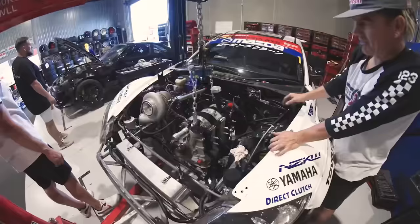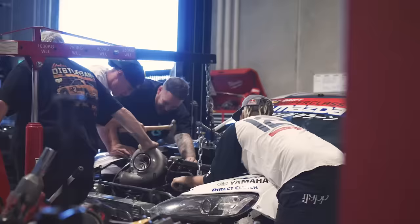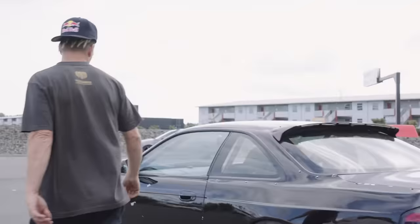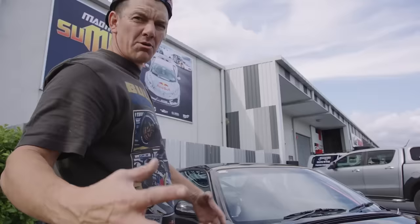But a good thing with these, so the RX-8's like the MX-5, it's got this big recess in the firewall, which allows you to move the engine back. Horrible. It looks even better now. I've axed it out, pulled all the graphics off it. It's got these massive Porsche brakes. I'm actually going to take them off because they're a bit overkill. Calipers are so big, they're smacking the lower control arm.